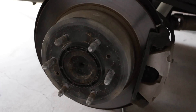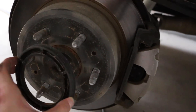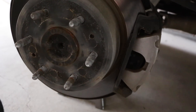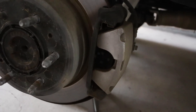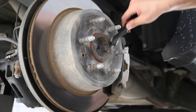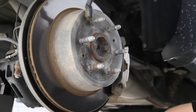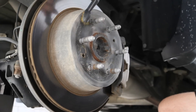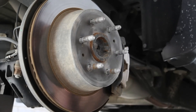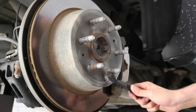Once you get the wheel off, there's that plastic piece — if you have aftermarket wheels that don't fit on the center hub, you'll have a little plastic piece. Go ahead and take that off and keep it. Now you want to clean off your hub — just get a regular metal wire brush and scrub it clean. A lot of people say you don't have to do it, but personally I recommend it because at Discount Tire they told us to do that on every single vehicle.